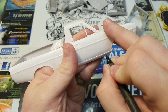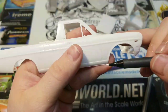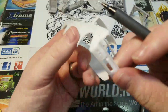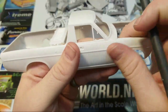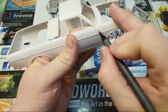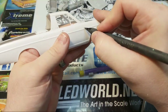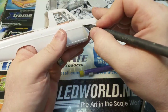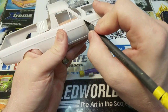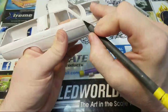You've got to get an even groove in there so that way it cuts better. You have different thicknesses in plastic because of the molding. What I'm trying to do is get it to where I have one easy flow without all the humps, because if you don't do that and you go down with pressure and hit that bump, you'll lose the channel and can scratch the body. You want to keep an even flow — that's how you should do it even when opening doors. Make sure you get through evenly, not skipping.